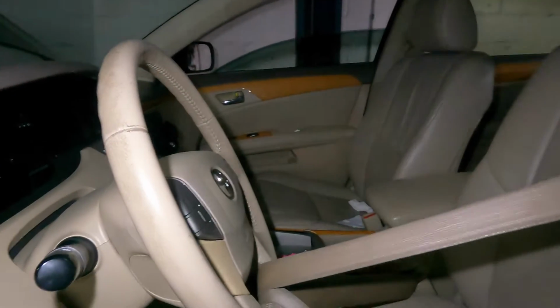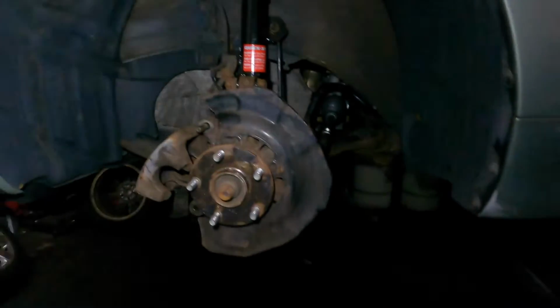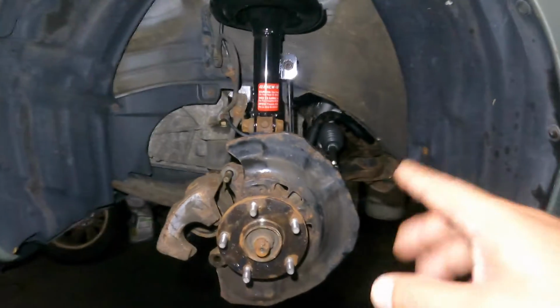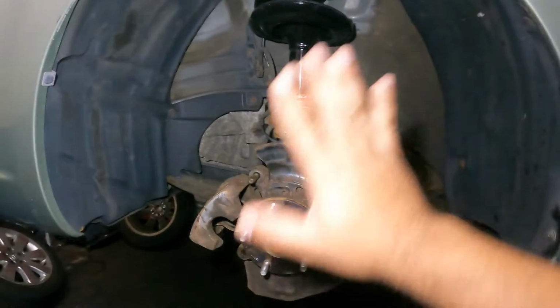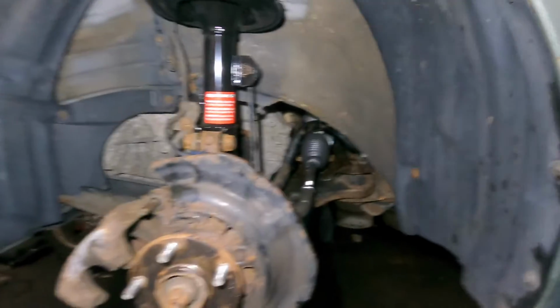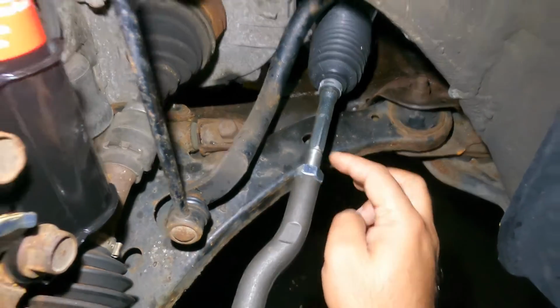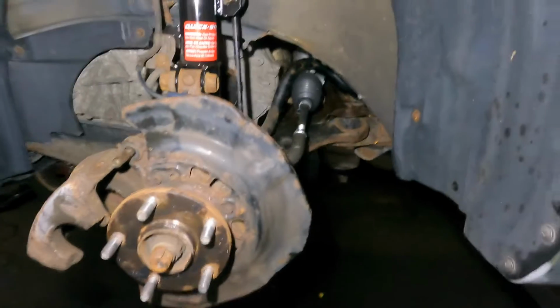And the last thing you want to do is remove your steering wheel lock, once everything is tight. Again, like I said, center your wheels before you start. Lock up your steering right in the center, so everything is centered. If you can manage to count these threads, at least outside, if it doesn't open over here, at least you'll know where everything sits.